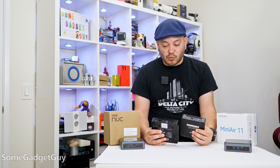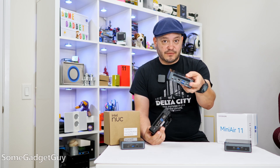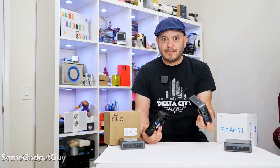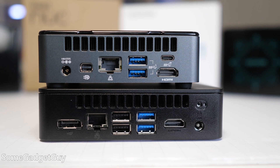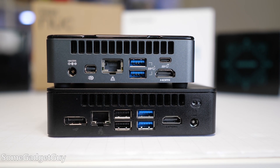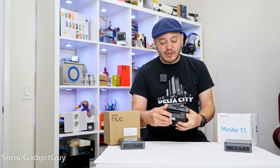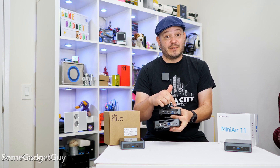When we get to the rear panel, we've got some great I/O options. Full-size DisplayPort and full-size HDMI on the new NUC. On the Geekom, we have full-size HDMI and mini DisplayPort. We only have two USB-3 ports, but we do have that USB-C which can be expanded really easily using something like a laptop hub. I absolutely adore that both boxes have full-size Ethernet. This is one of those solutions where if you're cabling it up in a business or using it for signage, you're probably not going to want to go over Wi-Fi. They both have Wi-Fi and Bluetooth, but cables are always going to be more consistent. For myself personally, I definitely would have given up the two accessory USB-2 ports to get that USB-C.